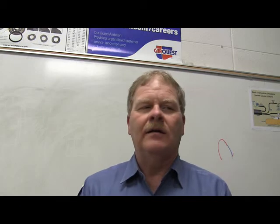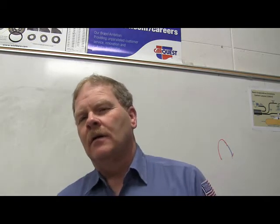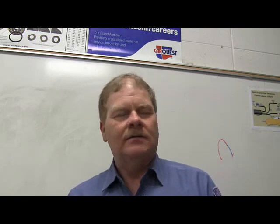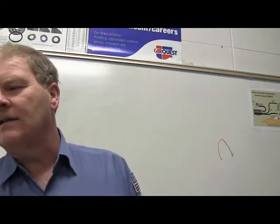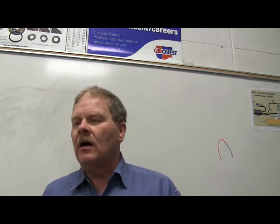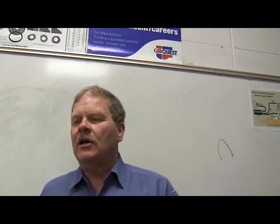What do you think? Worley? I always have to ask Worley because Worley's a thinker. What about you, Clark? What do you think? Printed circuit's what I was talking about a while ago. If it's carrying no signal to that gauge and it's burned in two or somebody's damaged it, then you're going to have an inoperative gauge, right? And if the appropriate trail is messed up. So that one's right. Now let's look at Technician B. This is like two questions in one, and most people hate that because they feel like they're doing extra work when they get a Technician A and B question. Technician B says faulty wiring or component failure within a fuel gauge circuit can cause a fuel gauge to give inaccurate readings.